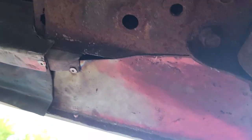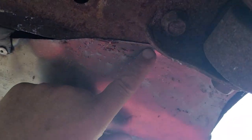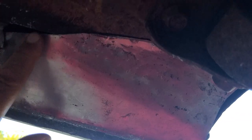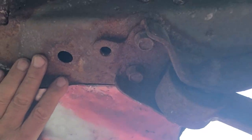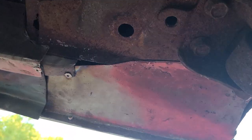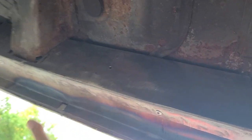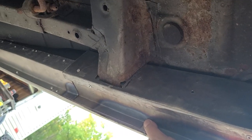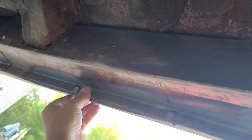Take a look at the back at the torque box. That's all solid now and I'm glad I got this done. This is all just riveted and screwed in right now - look at how strong that is. Now wait until I pull it up next to the garage and go ahead and weld that up. That is the situation at hand.